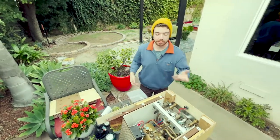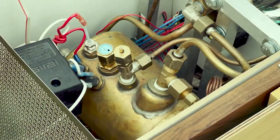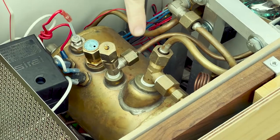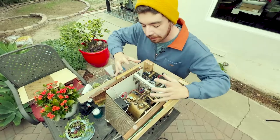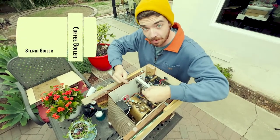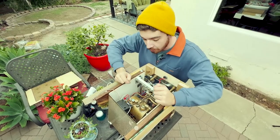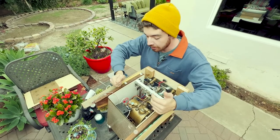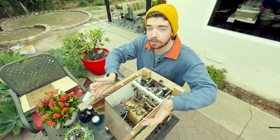I know there's a lot to look at here, but it's pretty simple. That big hunk of brass you see inside — that is the boiler. Now it's actually two boilers inside of one. That small little hose coming out the top is its own separate tube or boiler that is inside the other one, so they share the same heating element and it doesn't draw too much power. This is known as a heat exchange machine, and they're very common with home machines that need to keep their power draw down so you don't need an industrial power supply.